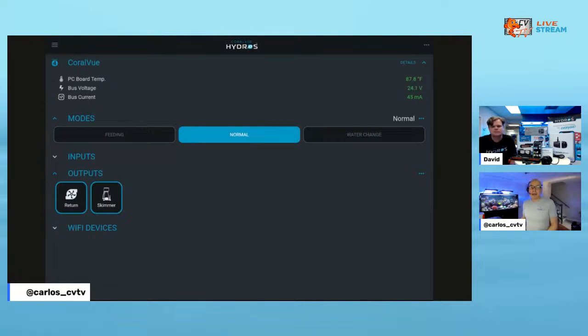The only thing that we need to keep in mind is that, just like anything else, only the first device, when you first create your collective, has its settings imported into the collective. So when I create my collective with the Control 4, all the settings from the Control 4 are going to be imported into the collective. Then when I add any subsequent device into the collective, those devices are going to come in as blanks. Okay? They're going to come in as blanks. That is just the catch of the collective. All right? So let's go ahead and do that.